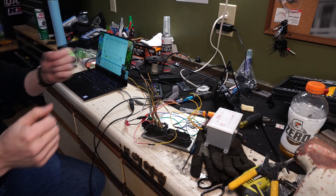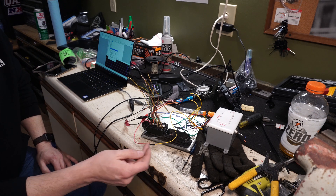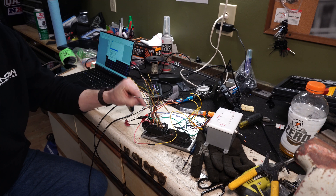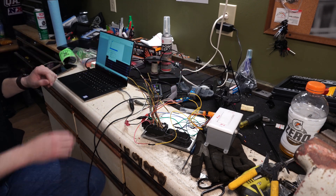So how do we decipher what that signal is? We're going to dive into that right now. Let's go over to my test bench. I've got the old test harness set up here, but instead of running it into an ECM, we've got it tied into the TCM. I'm using the cut harness from that to apply power — there are three points that needed power, just kind of half-assed shorted in there, and then ground. Over here I have my CAN bus going to my Microchip CAN bus analyzer — I'll put a link below — and I've also got my HP Tuners MPVI2 plugged in.